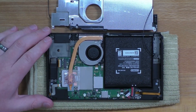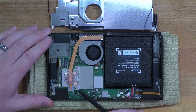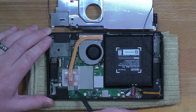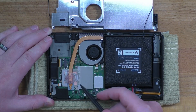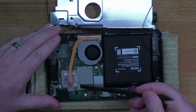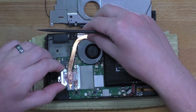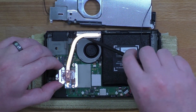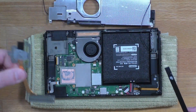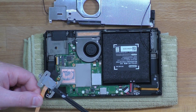That's going to get us to our next level. You're going to lift this heat pipe up here — you just want to get underneath it. There will be some suction because there's some thermal paste there, but you just want to try and pry this bad boy up. This whole thing will lift out, but it is stuck down in there — there's some adhesive. Just kind of lift it up and there's your second location: right on this copper shield and right on the bottom of the heat pipe.